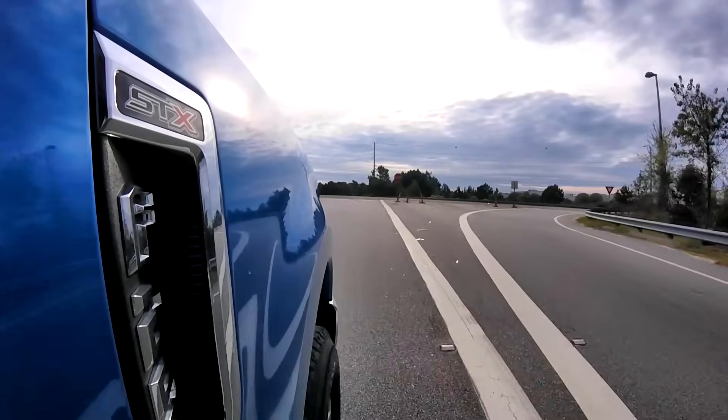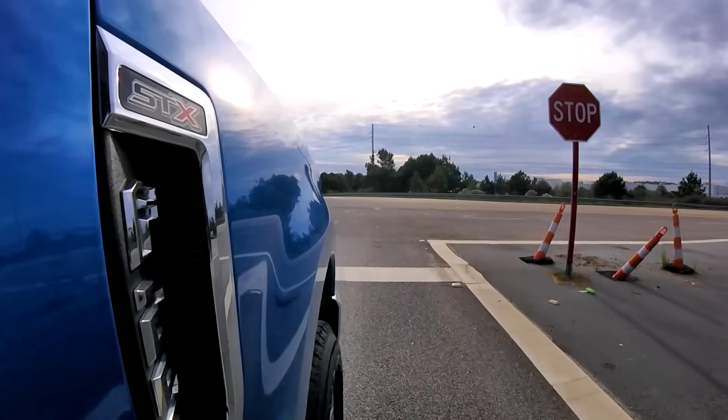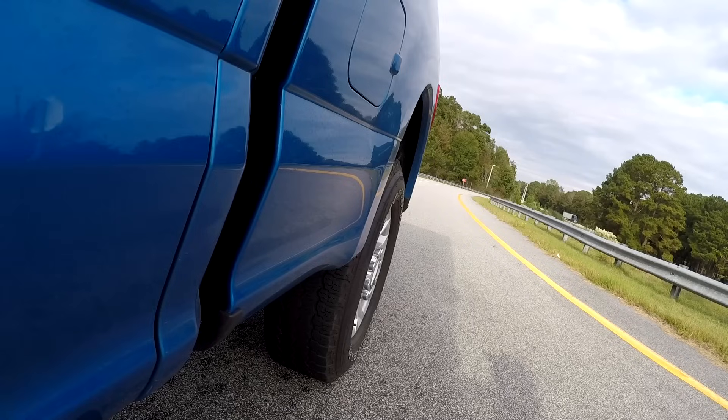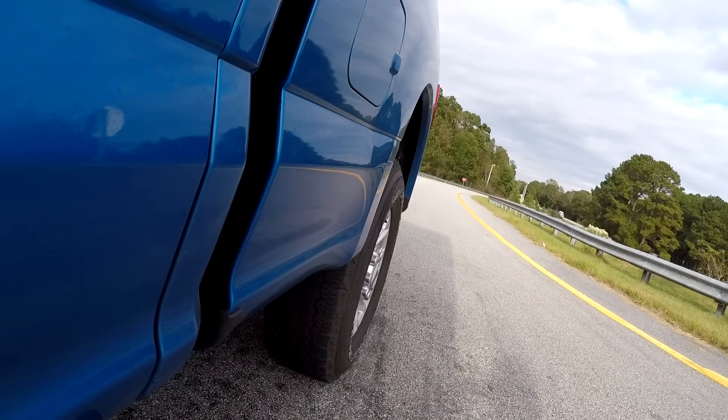We just got this thing off the dyno an hour or so ago and have been driving around a little bit. The next step is to hook a trailer to it and go tow about 10,000 pounds — gotta do some tow testing. One big thing we've got to do is get a way to read air intake temps while towing so we can make sure everything's staying nice and safe. We're also going to try to do an 87-octane four or five pound tune that can be towable — the goal is to take the four-pound pulley, go 87 octane, and pick up another 60 to 70 horsepower out of it.